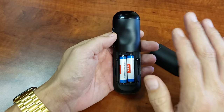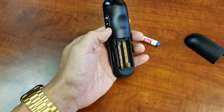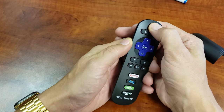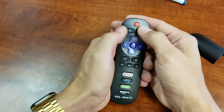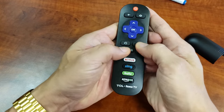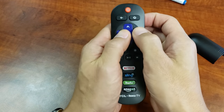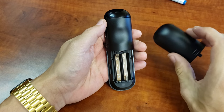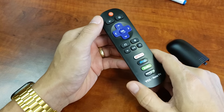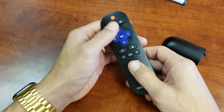If it's still not working, then do the same thing again — take the batteries back out. Hold the power button down for about 10 to 15 seconds. After that's up, let go and then start pressing every single button like a madman. I've gotten tons of remotes working like this. Go crazy, give it a few whacks. Then go ahead and put your batteries back in, don't put the back plate on, and see if the remote works. If it does, you can put it back. If not, try it again — pull the batteries out and do the same steps over again.